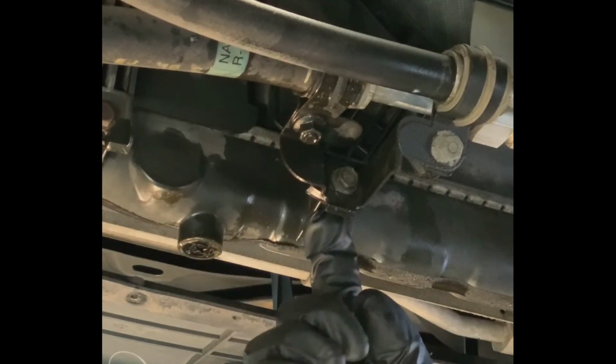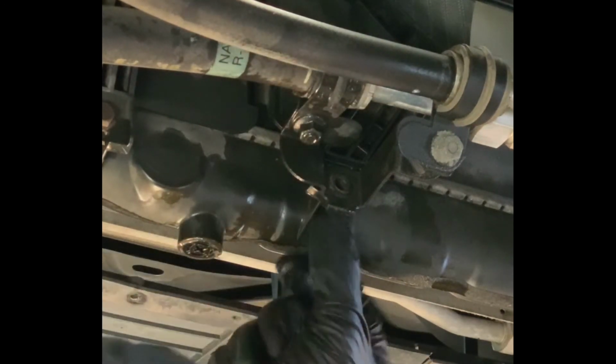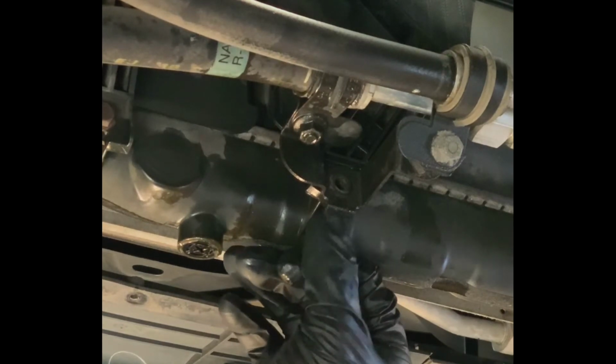We should be able to lift everything up with the fans, and the whole radiator should be out. So starting off first, got my 10mm ratchet. Kind of squeeze that in there. Gently bring it out. There's a little squared nut on the back end that I want to not drop. And got my finger loose at this point. And that's that. Square nut still up in there. Don't want to lose it, but I think I'll come and get that in a little bit.